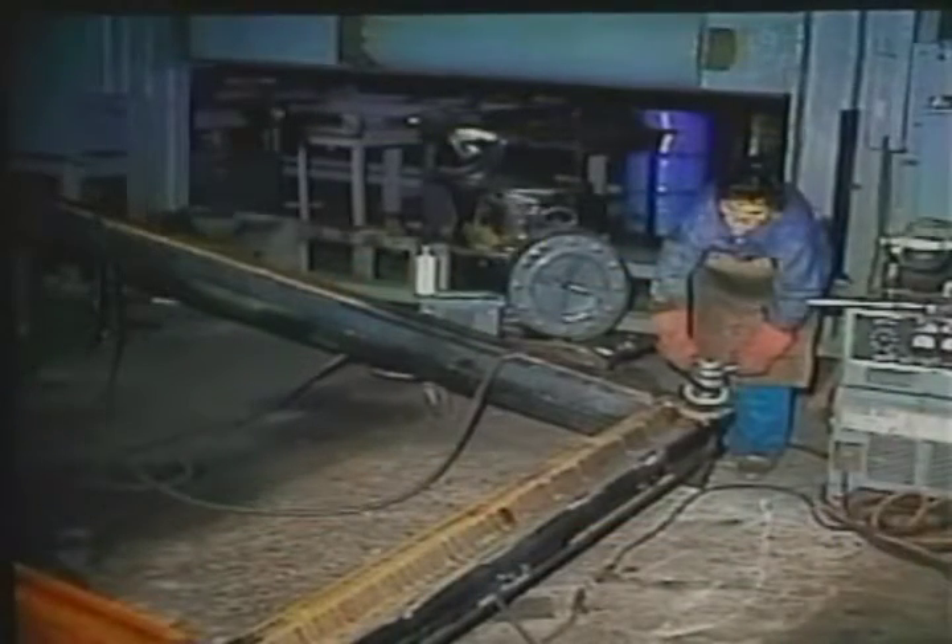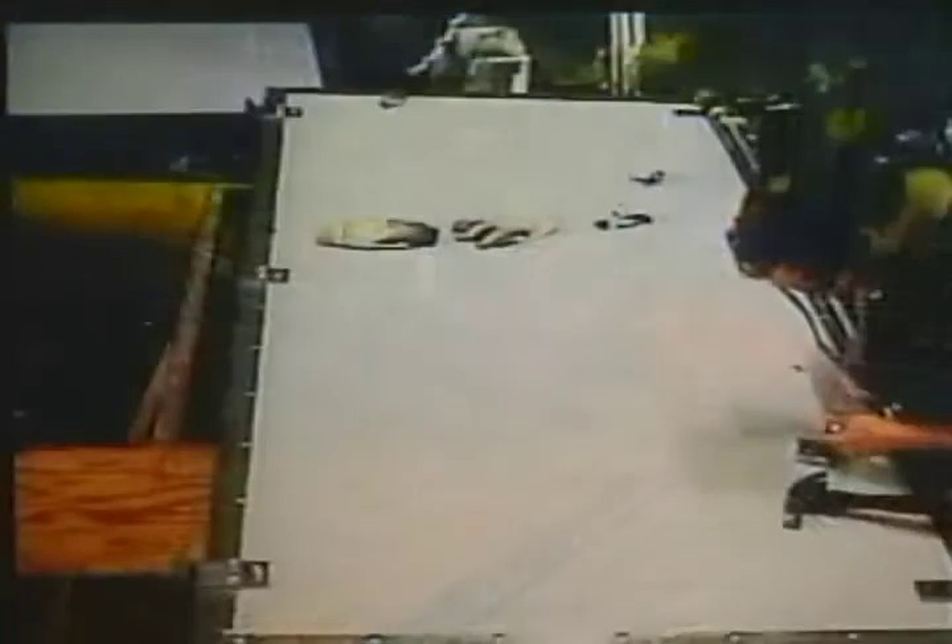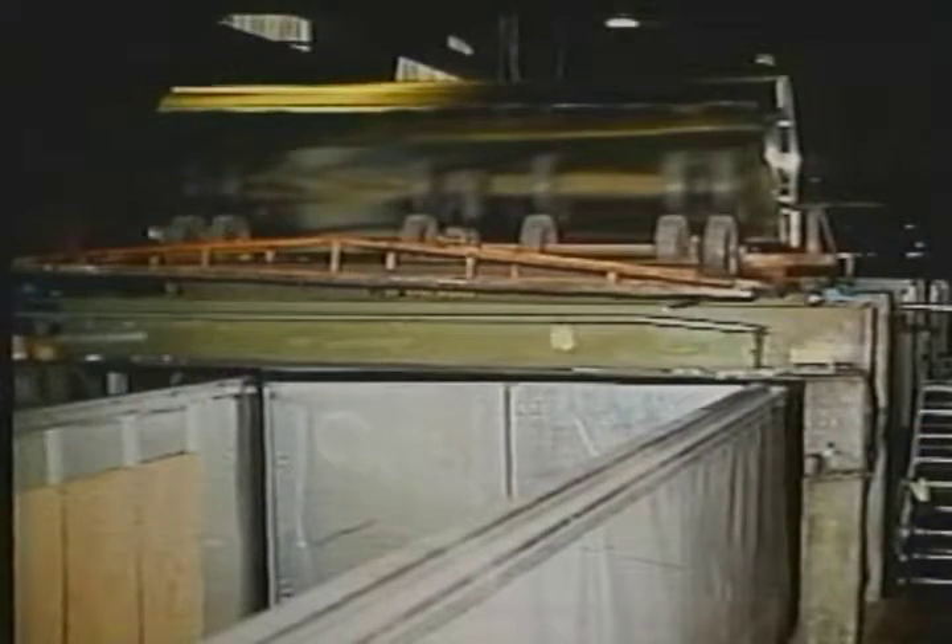Finishing of the frame readies it to accept the doors, which is the next step of trailer fabrication. TIP-specified doors are made of .025-inch aluminum over three-quarter-inch plywood cores. The inside of each door is faced with a galvanized steel sheet for added strength and durability. The strength and tight seal of these doors is critical to customer satisfaction and a trouble-free fleet. With the mounting of the rear door assembly, the trailer is now prepared to receive the roof.